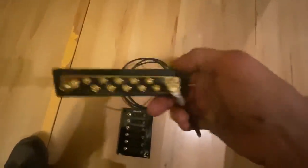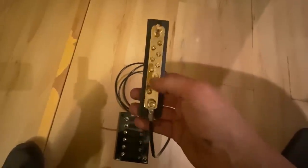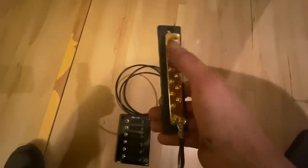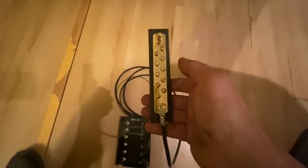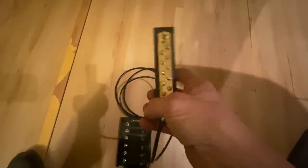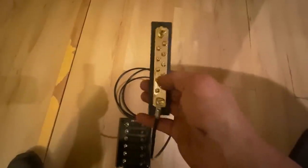The other way of distributing the negative side of the circuit is one of these terminal bars. It takes the negative from the battery and distributes it — you unscrew the terminals and put in whatever connections you need for your lights, water pump, whale gulper, oven, and so on. If you need more terminals, just link another bar to it. Two bars side by side should be enough for all the circuits on most narrowboats.